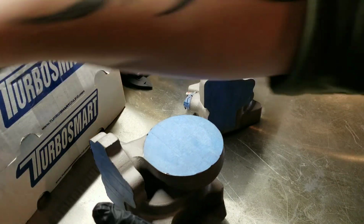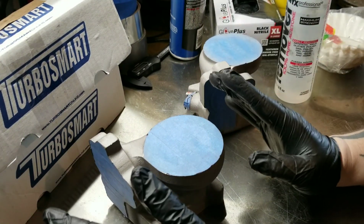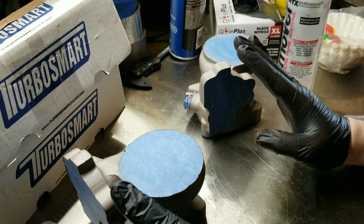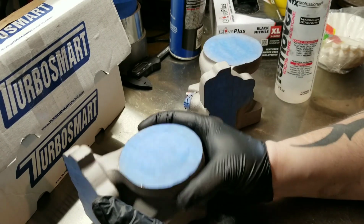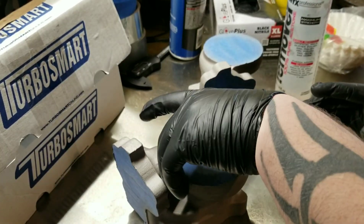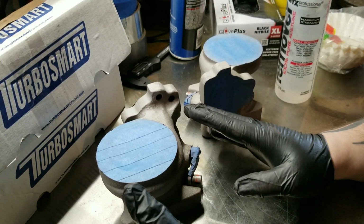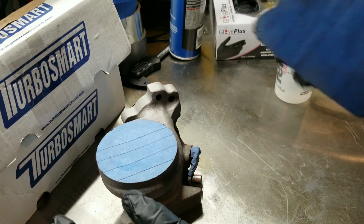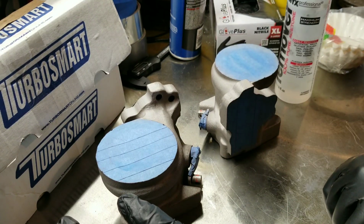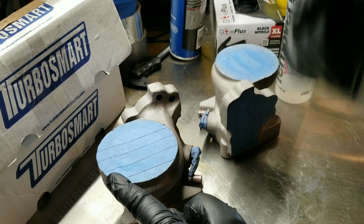But now I'm going to take the time and grab my trusty acetone and some coffee filters, and I'm going to go through and clean the heck out of these guys to make sure that I get all the contaminants I can off them. Then from that point, I don't know if I'm going to be able to hang them because these guys are kind of heavy. I'm going to see what I can do. If not, I might just leave them like this and put up some cardboard or something and shoot them in place, because I think I'll be able to do that with this, because there are no surfaces on the bottom that need to be painted. I just got to make sure when I'm done, I transfer them to an area with some hooks that doesn't have paint so they don't stick to the surface. But for now, I'm going to go ahead and clean these up just like the last ones.